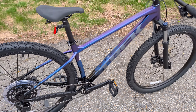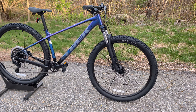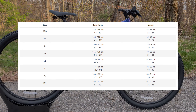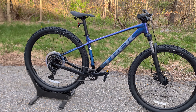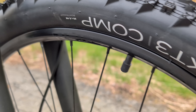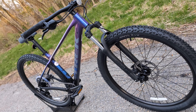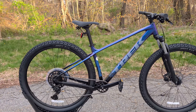All that comes together on an alpha silver aluminum frame, and this is where most of the upgrades are for the brand new model. The Trek Marlin series rocks a 100mm front suspension fork — all Trek Marlins have a suspension fork. The bike comes in a wide range of frame sizes, from extra small to extra large. Extra small and small rock 27.5-inch wheels, while medium to extra large use 29-inch wheels, wrapped in Bontrager XT3 Comp tires at 29 by 2.4, or 27.5 by 2.4 for the smaller sizes — a nice chunky, meaty tire.